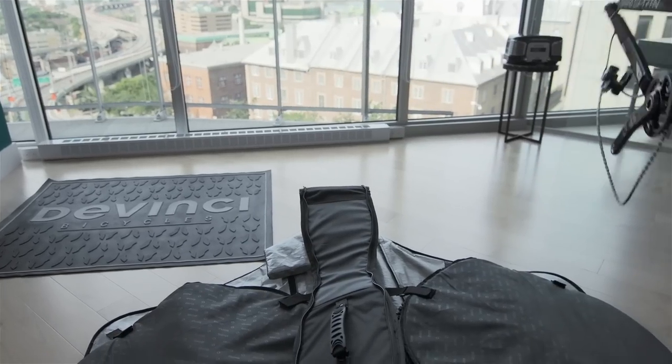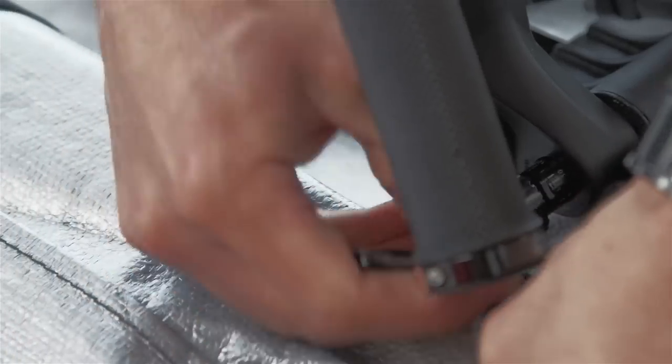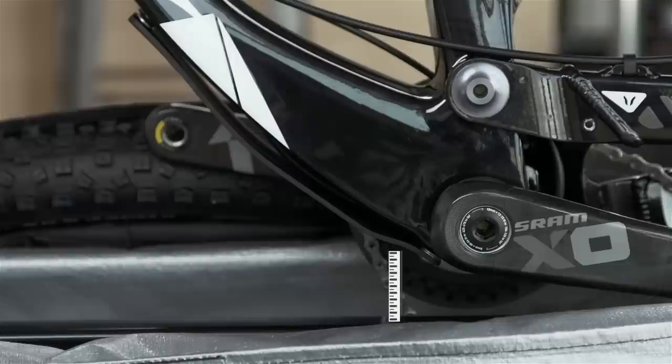You can then proceed to add your bike. For the back, adjust the rear axle adapter as you place the bike. Adjust the height of the bike so there is about 0.5 to 1 inch clearance below the big chainring.